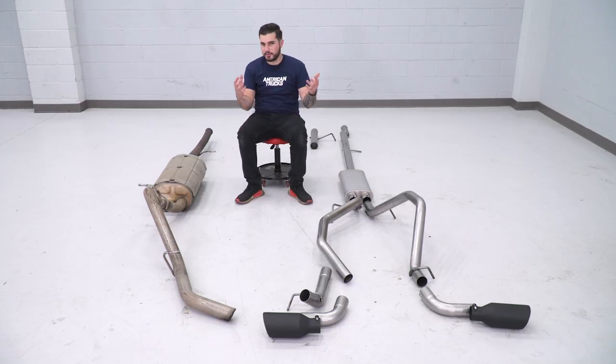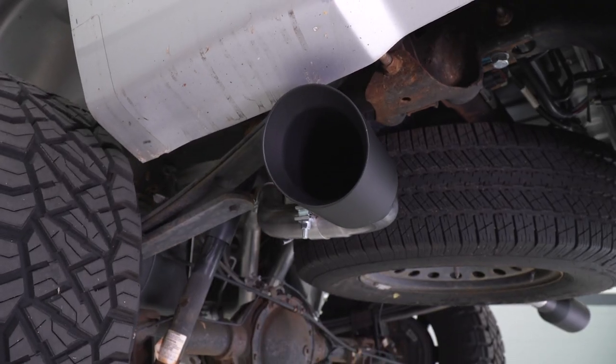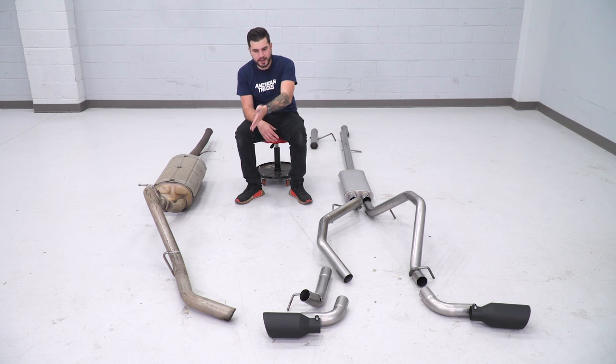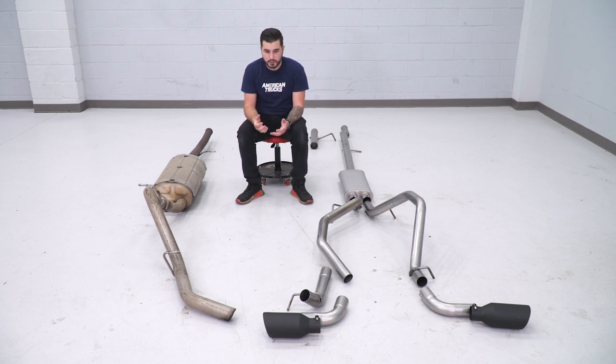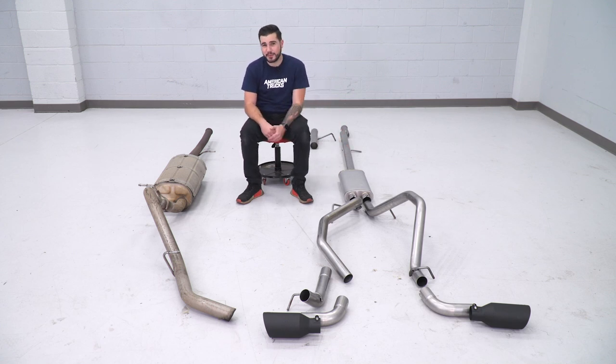Tips make a huge difference in this kit — one of my favorite parts. Your factory tip pretty much is nonexistent — it's really just a piece of metal that's slash cut and that's it. Your new tips are double-walled slash cut 4-inch tips with a black powder-coated matte finish. The 4 inches is obviously huge — your factory tip is 2.5 inches, so this is an absolute big bump up. You're gonna get two of them, and the matte black powder coating means it's way more corrosion and rust-resistant and gives you a nice stealthy look. Your whole exhaust is 409 stainless steel mandrel-bent tubing — 409 being the middle of the road, not paying as much of a premium as 304, but still more resistant to corrosion and rust than aluminized. Your muffler, on the other hand, is 304 stainless because that's definitely not what you want to rust out. A rusted out muffler changes the sound drastically, you have an exhaust leak, it can be miserable — so it's gonna have higher quality construction there.